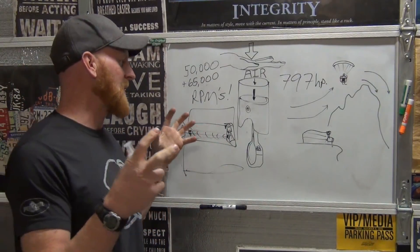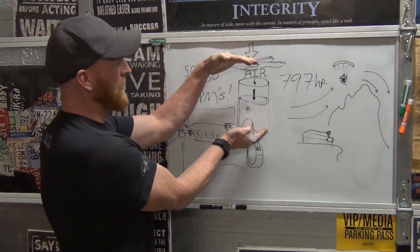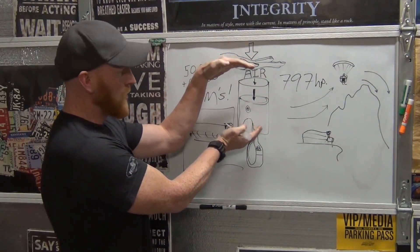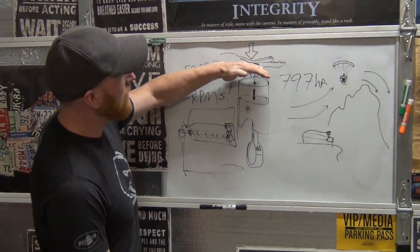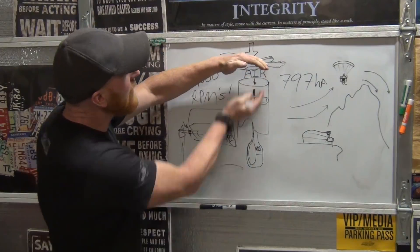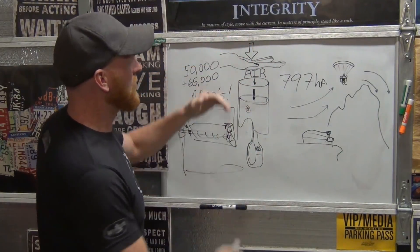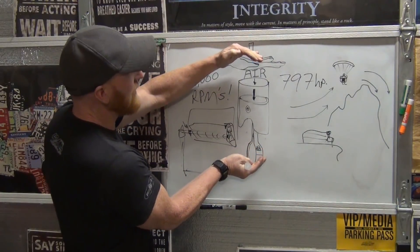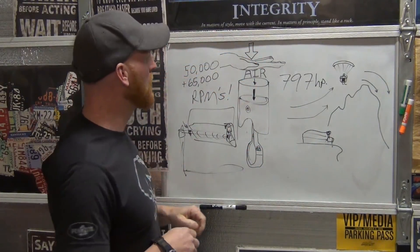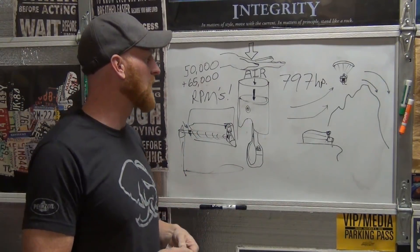You have an intercooler to help make that air really dense. Why do you want the air dense? So that you can fit more of it in a given space — your cylinder. Basically between the top of the dome of your cylinder head to the top of the piston when it's at full length. You want to get as much air into that, then the intake valves close and it compresses it even further. This enables you to go through fuel and air faster — it winds it up really quick.